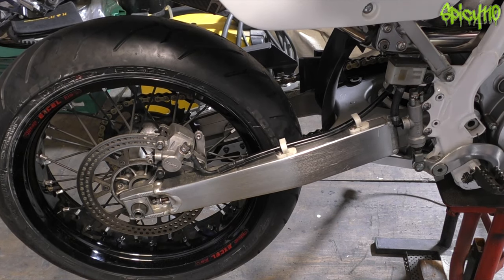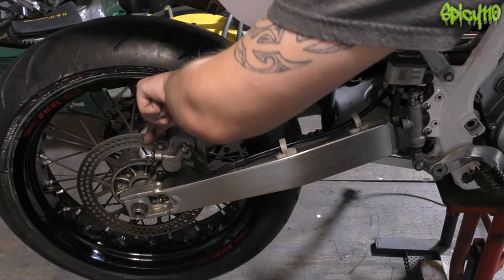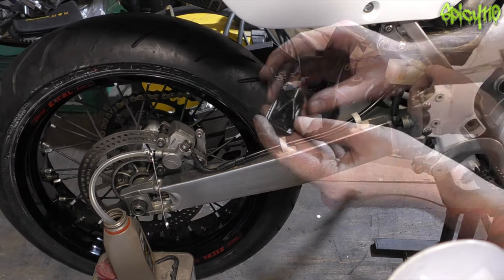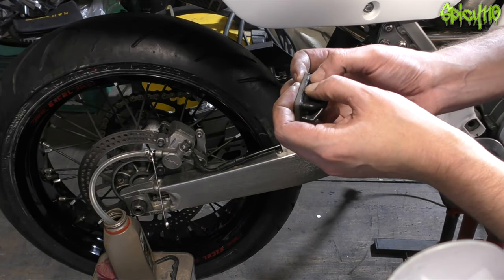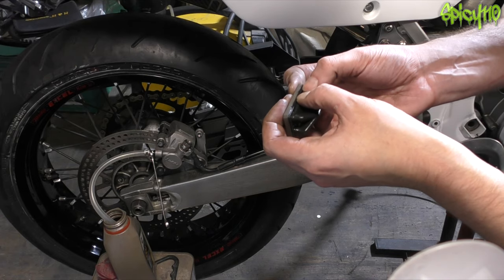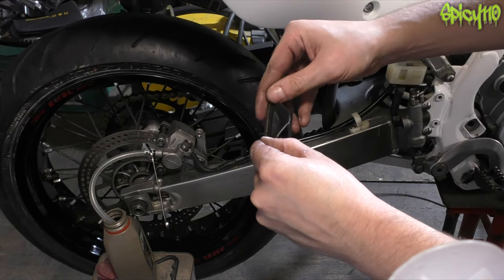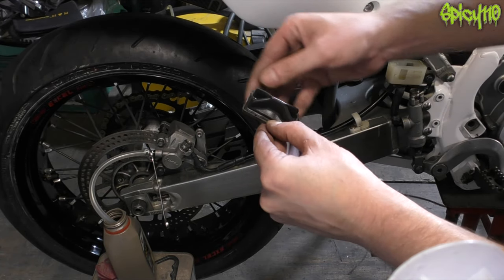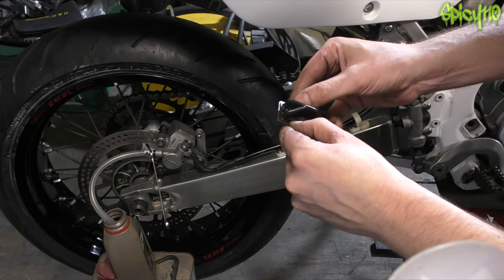I'm just going to take that off there for a minute. I don't know if that's affecting the air getting out to start with. I'll top the reservoir up. I've found it helps when you need to get the little diaphragm things in right and you want to make sure they're not being pinched. They seem on most bikes to actually sit in a groove in the lid, so if you get it in the groove in the lid and then pop it on, you shouldn't have any problems.